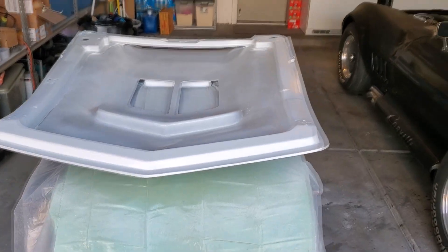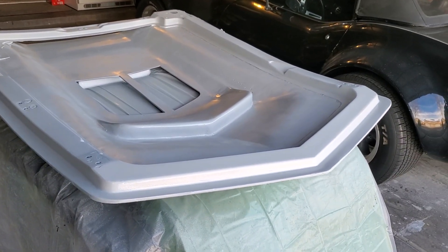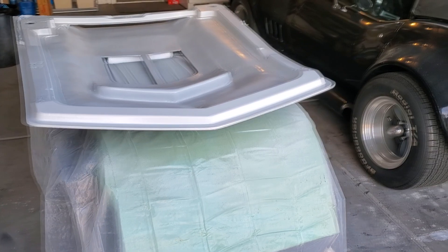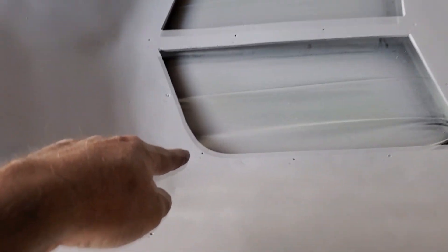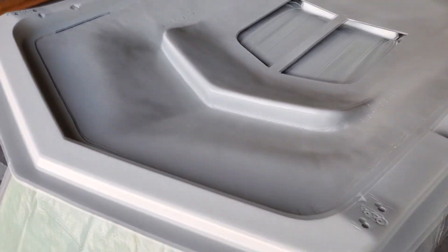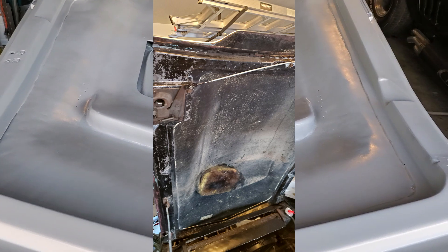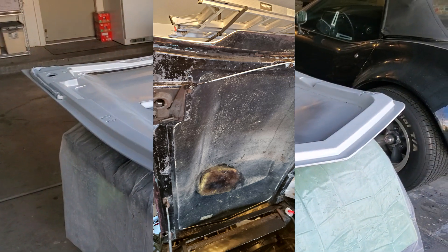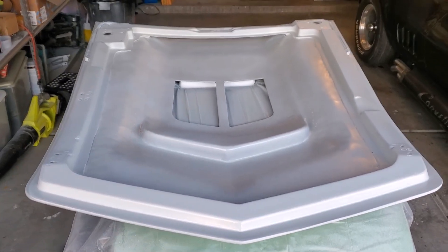It will take about a day before you can start sanding or doing anything to it, so we're done for the day with this hood. We'll get all the little areas done that I missed, then put on the filler primer — the black primer. And before I go too far, I need to drill out these holes for my hood scoop a little bit bigger because I'm using different bolts, so I just need to zip them out real quick. It's going to look really good. Most of it is done. I'll show you a picture of what the hood looked like when I first got it — man, it was horrible looking. It's come a long ways. Definitely an older fiberglass hood, whoever made it. We'll get her done.